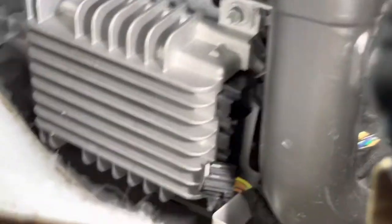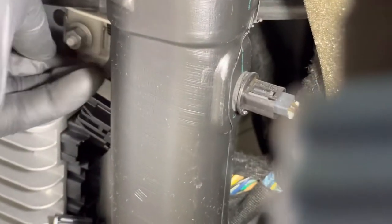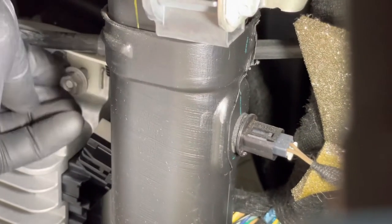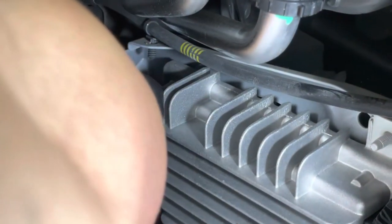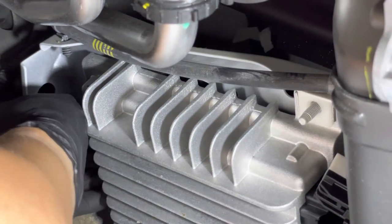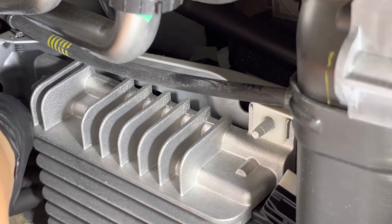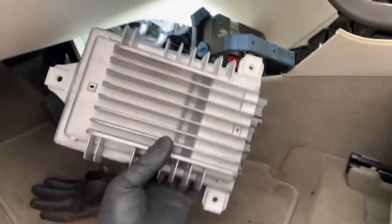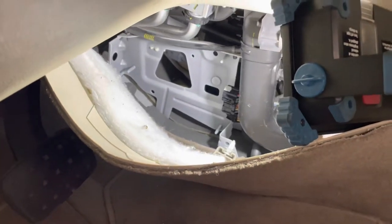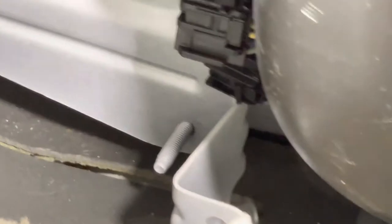So now take off those three 10 millimeter bolts. Just be careful not to drop them — it'll be pretty hard to get them back if you do. I already cracked these loose earlier, so you're going to do this kind of by feel. Go slow so you don't drop it because it might be hard to fish out. The last one is down there on this little harness. I need both hands so I'll stop filming that part. I got the amplifier out — that part was easy. I did exactly what I told everyone to be careful doing, which is I dropped the last nut. It is right there in the frame.